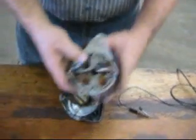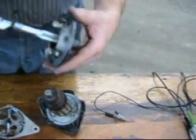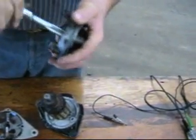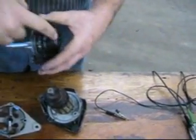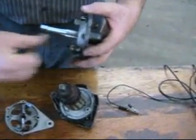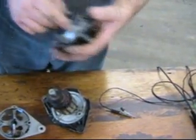On the back side, if you're trying to take the bushing out, here's an 11-16-18 tap. You put that down inside the bushing and turn it, and finally the tap bottoms out on the inside of the housing, and as you continue to turn it, it draws the bushing back out. That's how you get the bushing out of the back.